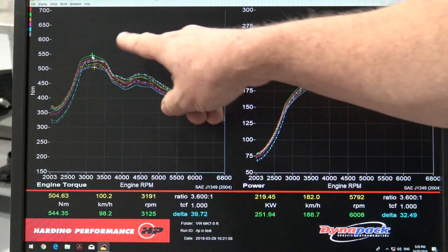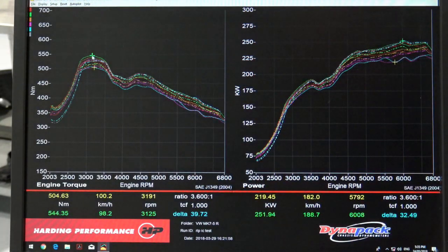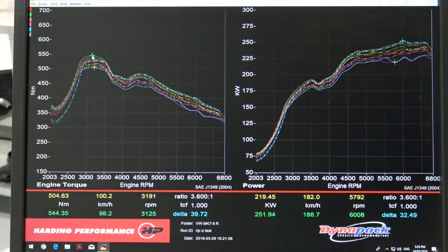This page shows you an overall group of a dozen runs done — six with intercooler, six without intercooler. You can see here we've got a delta of 40 newton meters overall and 33 kilowatts variance. This is all at the same ambient temperature of 31 degrees Celsius.